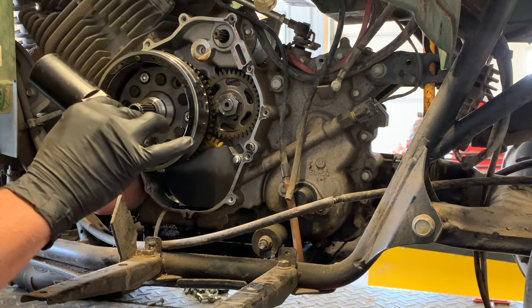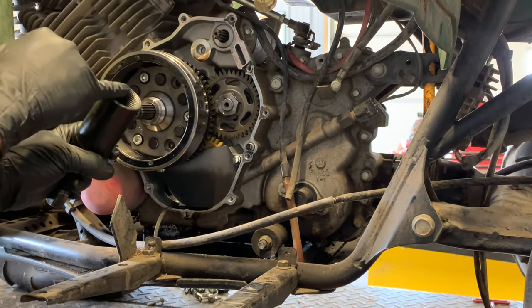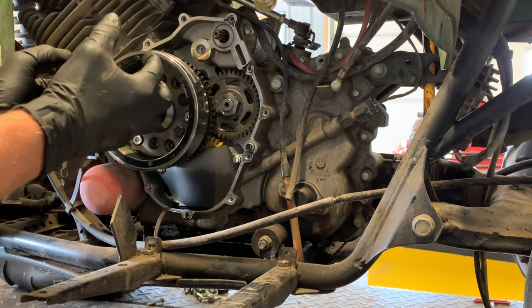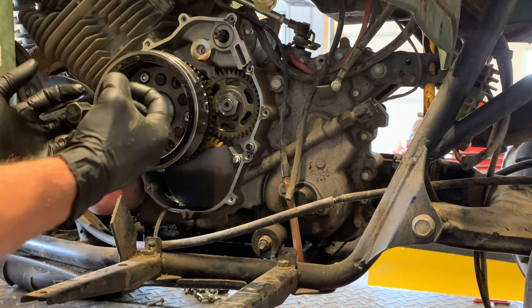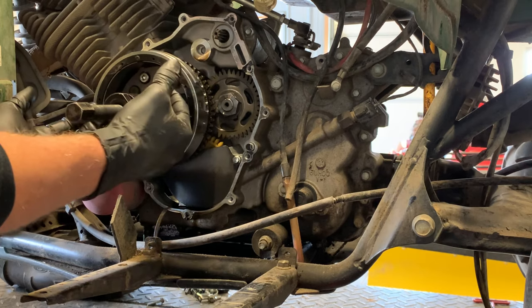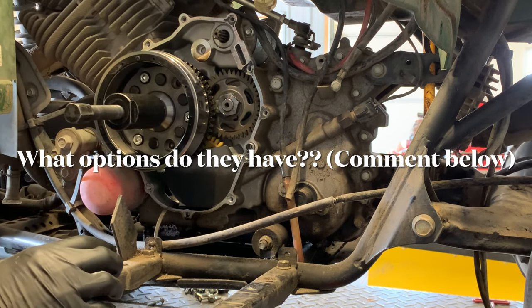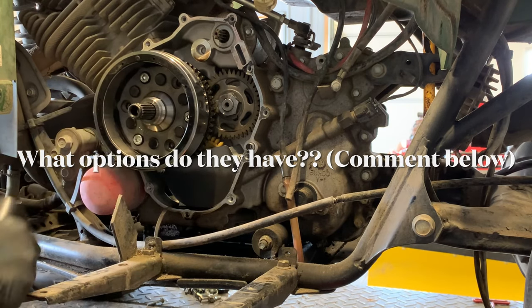Order the correct one from the link below. I'm honestly curious — if somebody stripped the threads on their flywheel, how would you guys suggest removing it? Leave that in the comments below. Now, something a lot of people won't mention: put your bolt back in that you pulled out of your recoil pull starter cup — you don't need the washer on there. Thread that all the way in. The reason is this bolt is going to go all the way in and touch your crankshaft. If your flywheel is really stuck and you're pushing the puller in with force, it's going to damage your crankshaft. So I put that other bolt in there to protect the crankshaft.